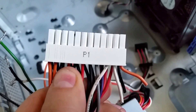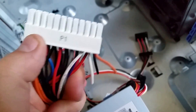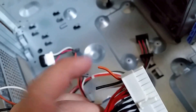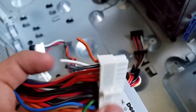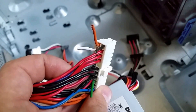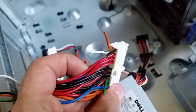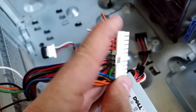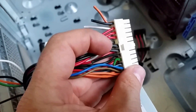What you're going to do is look for this P1 pin adapter — you can go online and Google that. Some computers will have a P2; that's fine too, you just get a different pin out, so you have to figure out which cables to cut. You're looking for a 12V positive and a ground. It's pin number 21 or 22 depending on which way you go. The white one is the 12 volt positive, and the negative right next to it — pretty much any of the black ones are negative.